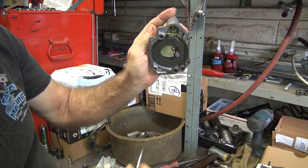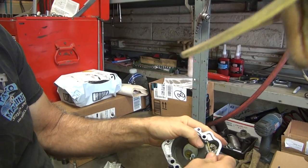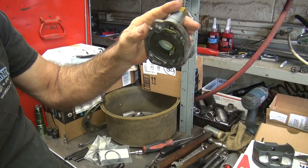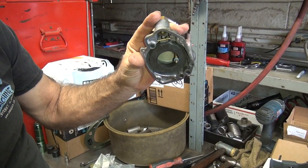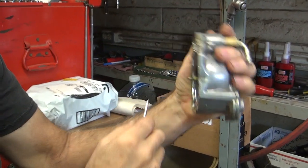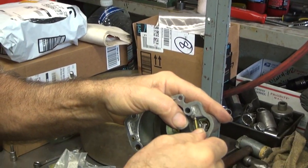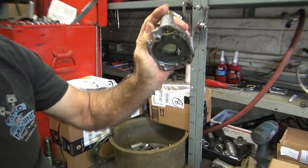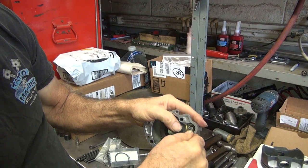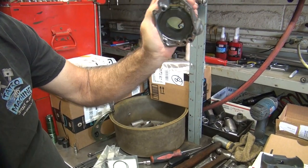I'm going to go back before I had it. What are you pushing on? There's a tang right here. So you hold it with your thumb and you push on this. If you push too hard you break the float — you can't be a heathen. You have to have some skills. See how close it is on that side too — you can notice how it's not even. I'll put it back where I had it. This side doesn't want to bend, that means I've got to push harder — or break it.